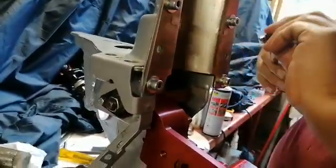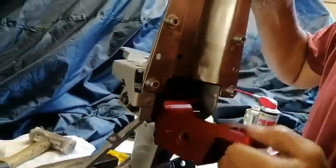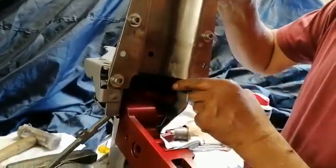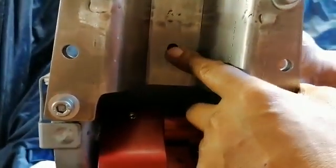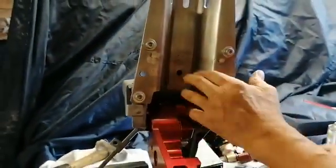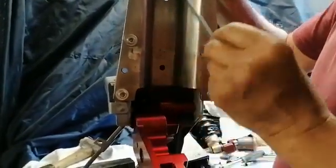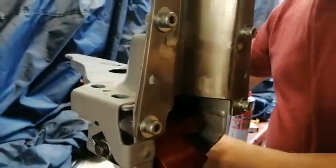I'm going to have to slacken these off again - I'll show you why. You can see everything clears. This hole has to be drilled through the spacer tube, and two M10 screws go in there - that's an additional stiffening point. But leave that until you've got the top shock point aligned. Having said that, you can do that because there's enough play in the whole setup to allow that to fasten without impeding the movement on the top shock.